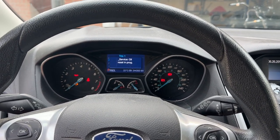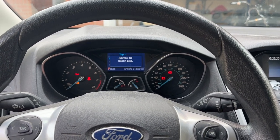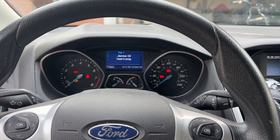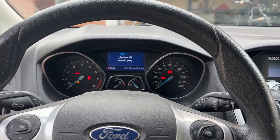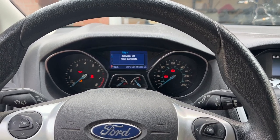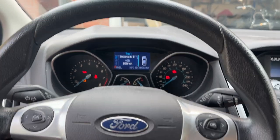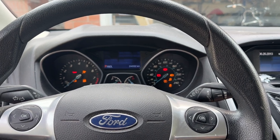What we're going to do is just keep holding the brake and gas pedal and let it do its thing. Still just holding down the brake and the gas pedal — it's going to take another five to ten seconds or so. And there we go, oil reset complete. We can let the brake and gas pedal go.